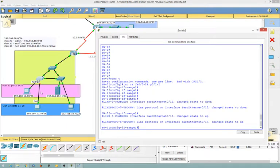That's a fair bit of time when we know that there's no switch down there. This is spanning tree negotiating with this PC to see whether it's a switch or not and whether it needs to modify the root bridge and all these other things. That's going through our whole process of listening, learning, forwarding, and blocking to start. And that's too long for our PC. We want it to boot up a lot quicker, and there's reasons for that.